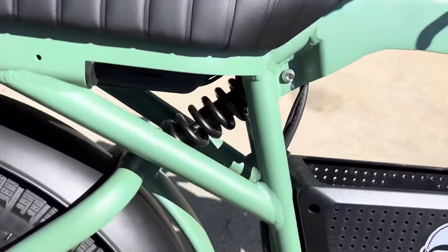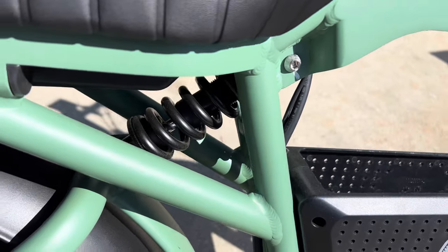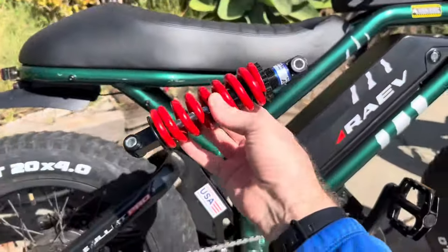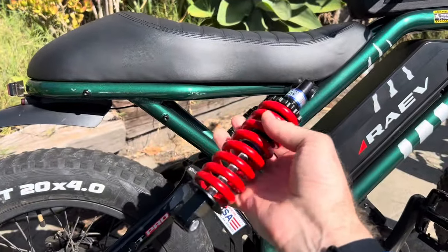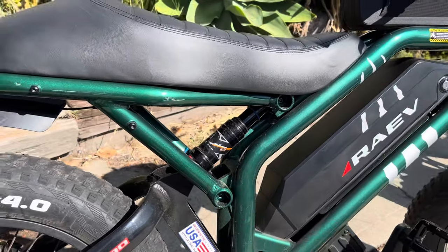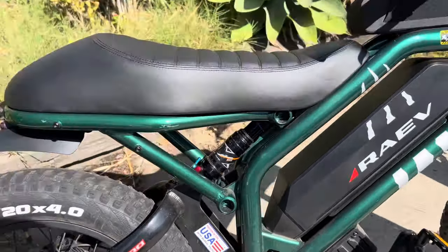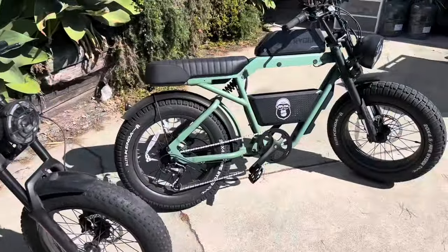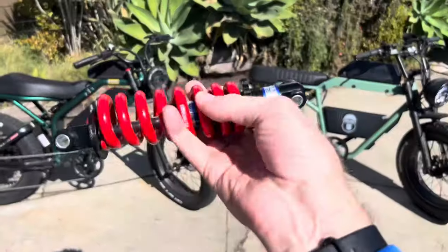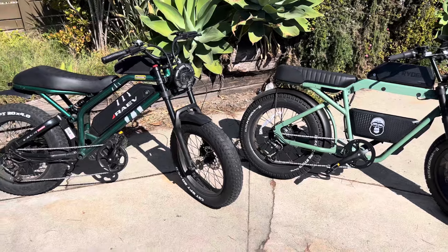Both of them have rear suspension as well as front suspension, but the rear suspension is just a basic spring setup, so what it comes with isn't very good. The Rave comes with a 1000 pound spring that I really didn't like — I ended up replacing it with an AirShock. I bought it off Amazon for $100. I would recommend that upgrade no matter which bike you end up with, because there's no damping on these springs and you're going to want to swap it out for an AirShock.